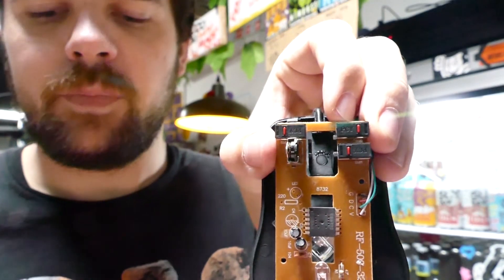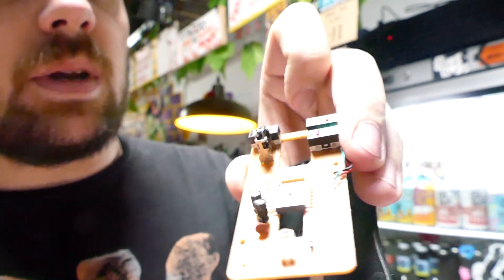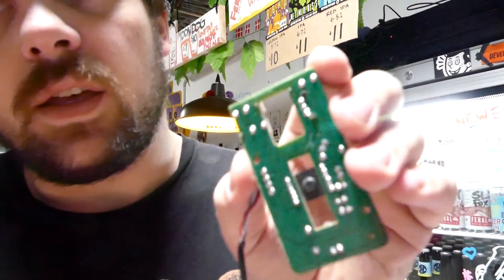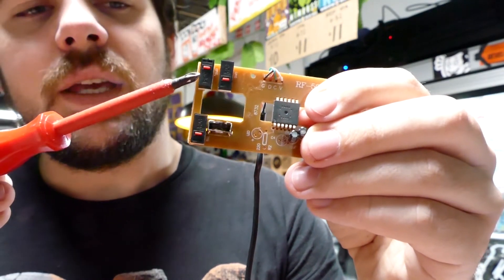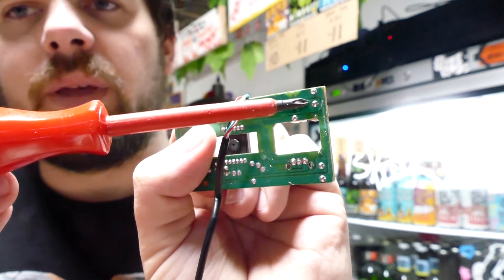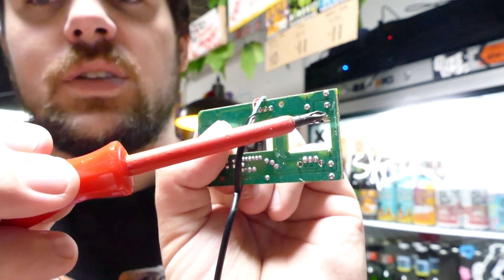This little guy here is the middle click button. You've also got this little bit of plastic underneath that links up with the LED. These mice are really cheaply made, so things are very easy to solder. It's pretty easy to look at the back of the switches and see which points are soldered in — one will be ground and one will be signal. You can unsolder them and run some thin wires in, then route that input to anywhere you like.